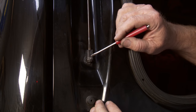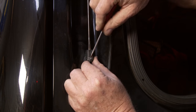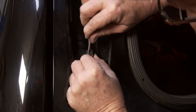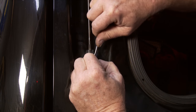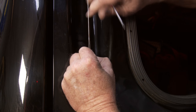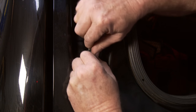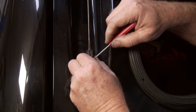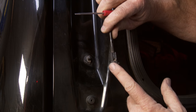As you can see right here, we've got a little clip on the bottom of this strut. We need to get our little screwdriver in here — I was doing it over here on the side. Pop it up a little, then come over to the other side and pop it. It's got to come out just enough, and you work it down. See how I'm pushing it down? Push that down and it'll come right off. You can leave the clip on here.